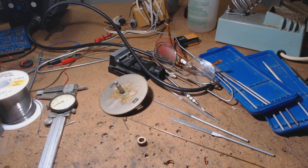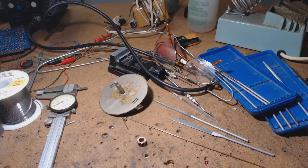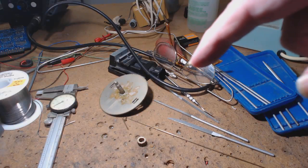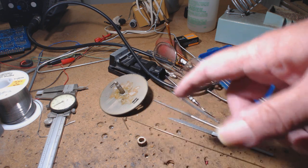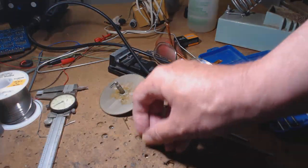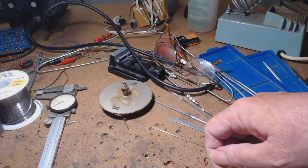But also, when you stretch metal out, it might flare at the end. I noticed that when I would squeeze, the gear wouldn't go back together, because there were some, I won't say burrs, but similar to that. When the metal pulled apart, it tore. So if you squeeze this gear, it wouldn't go back together. I had to open the crack up a little bit more with sandpaper or emery paper, and then squeeze it, and then check it with the calipers. And then when you slide it over this, it's a tight slide. It does go on. All right, the mainframe.